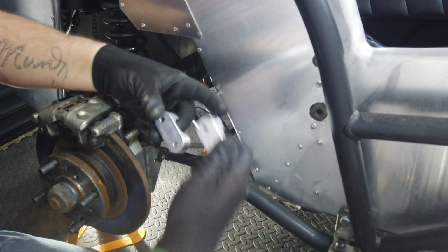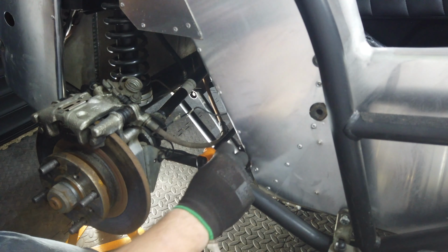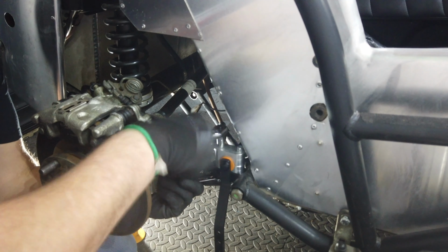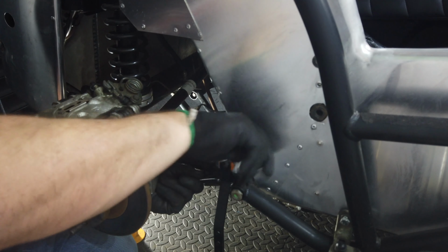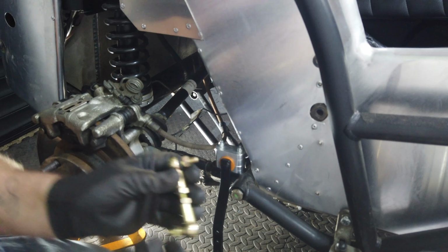I like the quality of the mounting for the anti-roll bar. Machined into the facing of the mounting is top and bottom. As you can see, one is thicker than the other. At this stage I'm just loosely tightening the nut and bolt. Fit the mounting on the other side before fully tightening. These are tightened to just 14 Newton meters. Next is the preparation of the drop links.